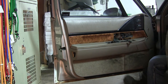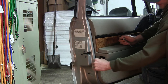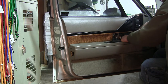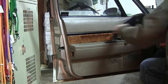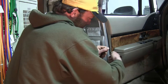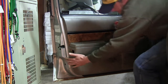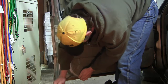Once the panel comes off, we've got two bolts in here — one down in here and one in here — that need to come out, and also this one right in here. It's easier to get to with a wobble extension or a swivel, but I seem to have misplaced all my quarter-inch drive extensions, so I'm gonna have to do it the hard way. Now that we've got those three bolts out, there's gonna be six clips — one here, one here, and four along the bottom. Just put the tool in and feel around to find them and try to pop them without breaking them.